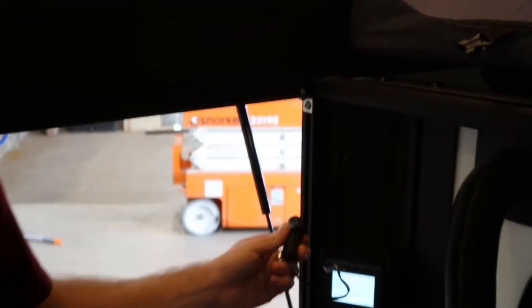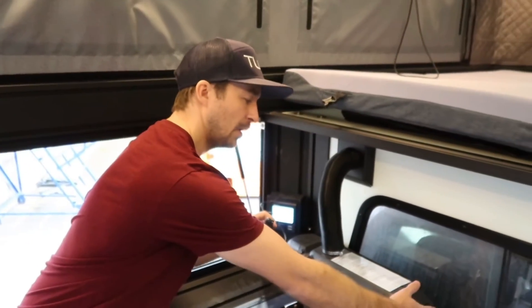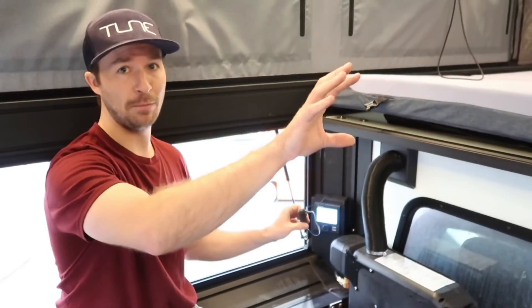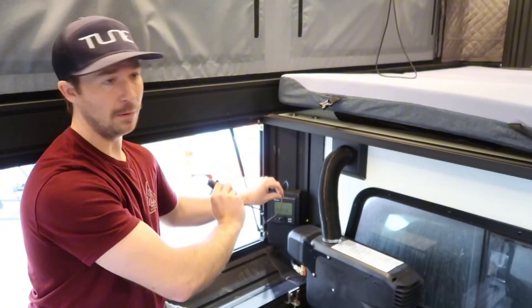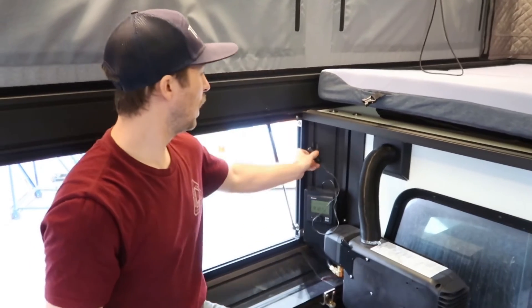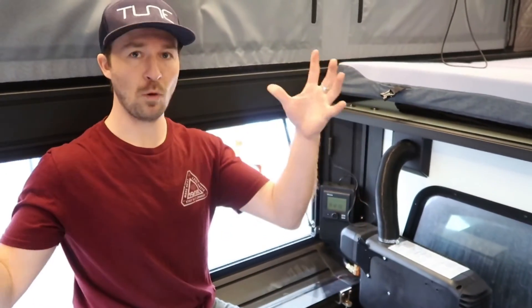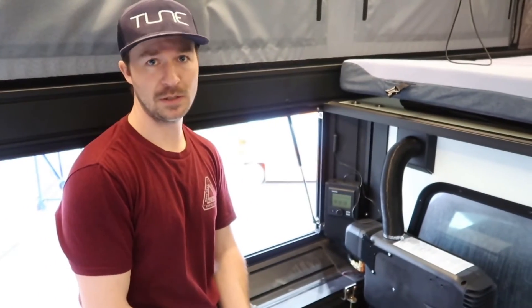What controls the heater — just like in your home — is this temperature sensor. The reason we made it mobile is so that you can hook a tube up to the Truma heater and run it into your bed platform. It's extendable, so it comes out and you can put it up in your bed. That way you're only trying to heat that area. The M1 is a really large camper, so at night you can end up going through a lot of fuel to warm a space you're not using. That's another nice feature for conserving fuel.